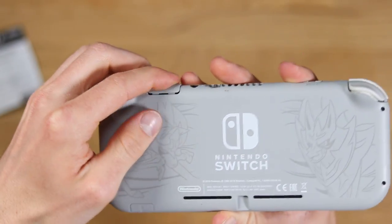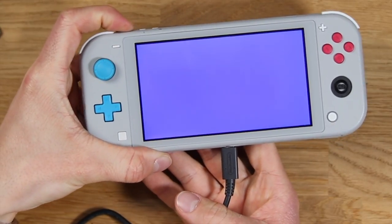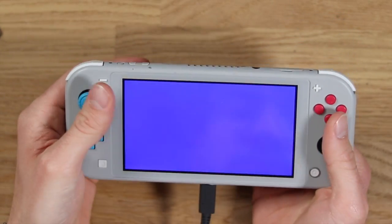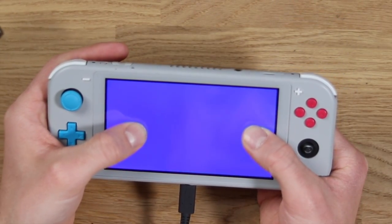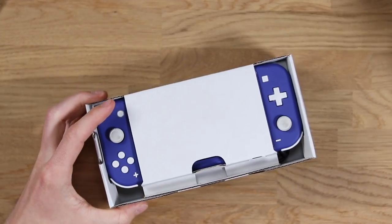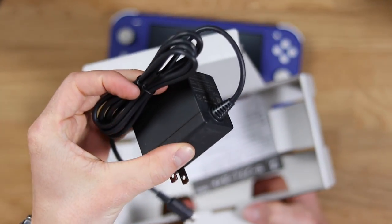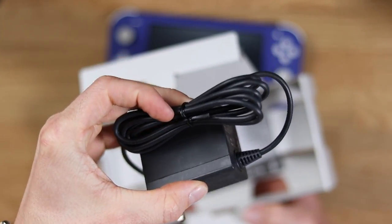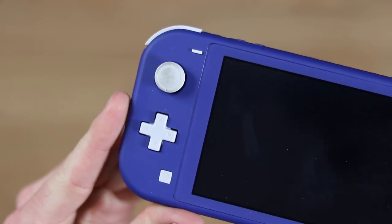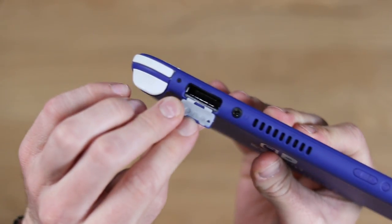There's no game or SD card, which is immensely disappointing, and there's a blue screen when you turn it on. The blue screen is often a repercussion of a faulty chip. Typically, if these things are bent, the chips can ever so slightly be lifted out of place and you won't get a connection on one of the solder balls underneath. I think that's what's happened here — it's a little bit above my pay grade, but I'll be taking it to a friend in a future video.